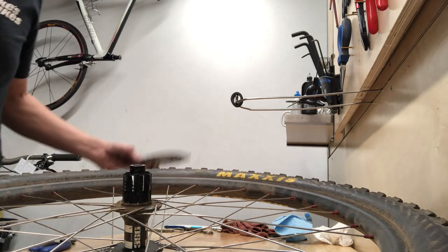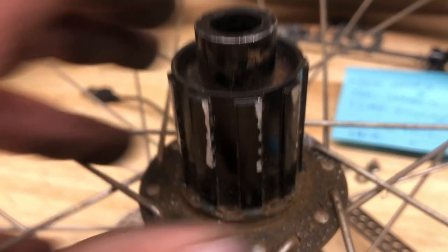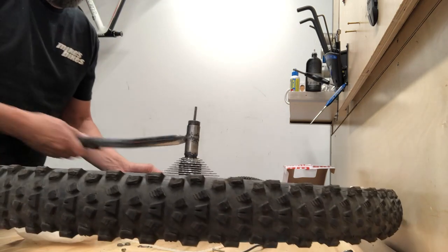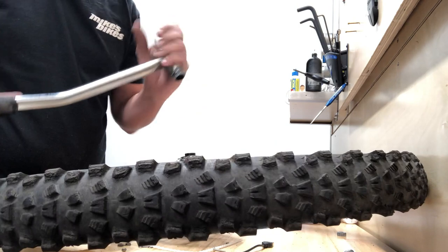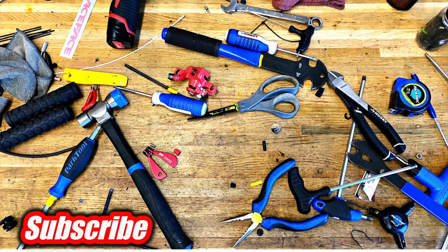After knocking them down, it'll slide right off. You can do this a handful of times before the cogs have dug in so deep that you'll want to replace the freehub body. Really, one of the best methods to keep that from happening in the first place is to torque the lock ring correctly — most cassettes specify 40 newton meters, which is pretty tight. A lot of guys like to grease the cogs too, but in my opinion that just facilitates the ease of digging in. So torque them down when putting the cassette on. Hopefully you found the video informative — see you guys next time.